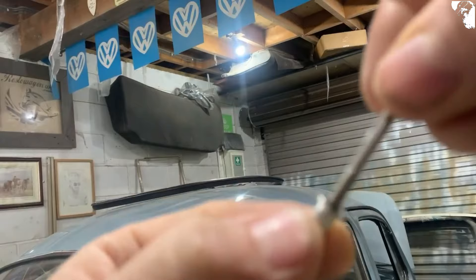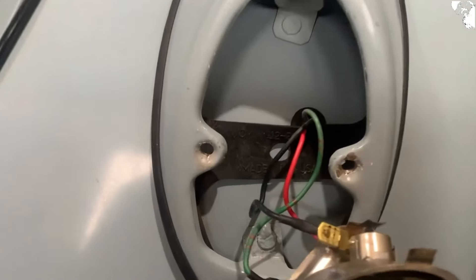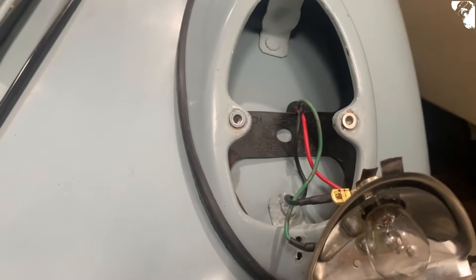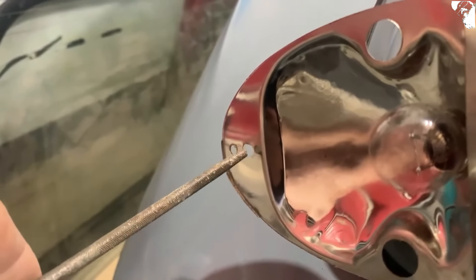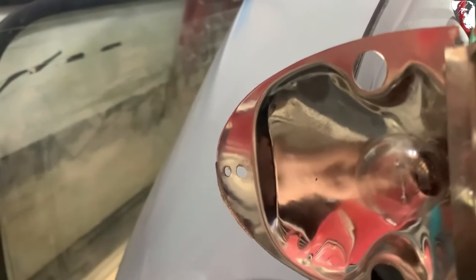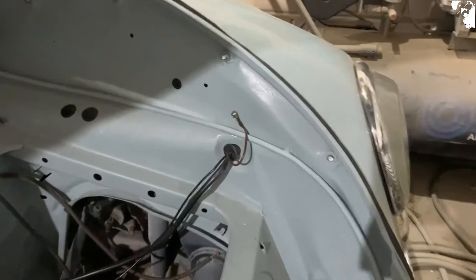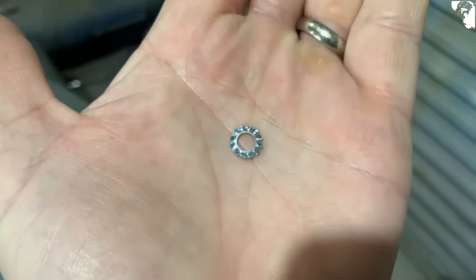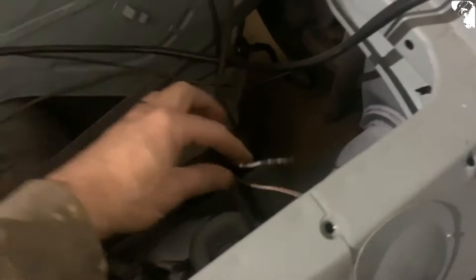Another issue is that I can't secure these lights down because the screws just pass straight through their fixings, so I'm going to have to do a little bit of cold welding and re-tapping them. I think I'm going to try and rivnut it — M4 rivnuts, the correct size. Nice fit. There's no going back now. Drilled out with an M6 drill bit to accommodate the M4 rivnut. Shouldn't have to be doing this really. Rivnut's in — not a great fit, these repo items.